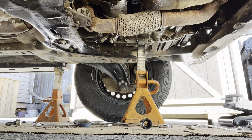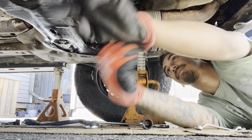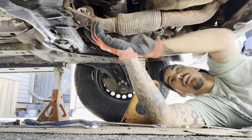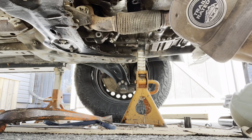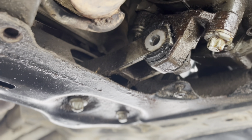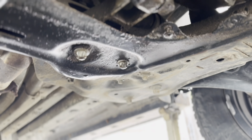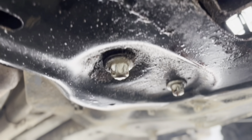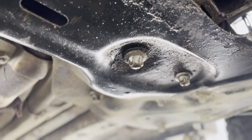To get the bolt out you're going to need to remove your exhaust from the hangers and just be able to move it so you can slide the bolt out — just need that little bit of extra play. You're also going to need to take out this bolt too to get the torque mount off so you can actually remove your transmission torque mount. Again, 16 mil — or actually a 5/8 as well.